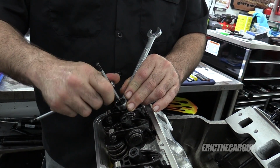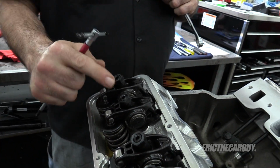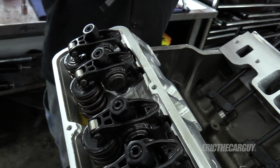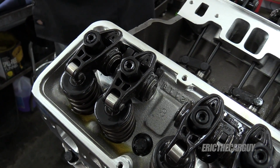The Chevy ran for a little while, got a little noisy at the top end. I went back in and did that adjustment in one full turn. After doing that, there have been no issues and the top end has been quiet. So my recommendation to you, if you're making this adjustment, go one full turn, not a half turn. And if they're all looking the same, that's a good sign. If you got one of these that's way off, scratch your head, look at it, do it again.